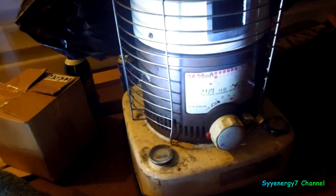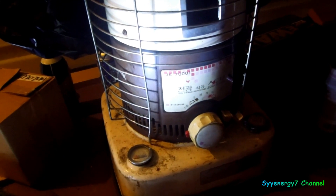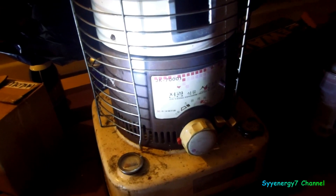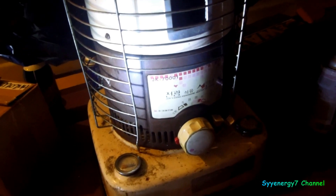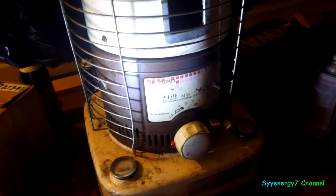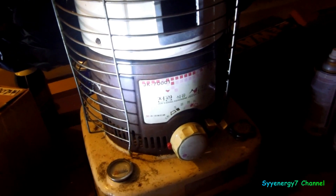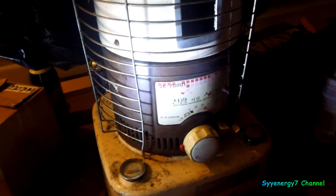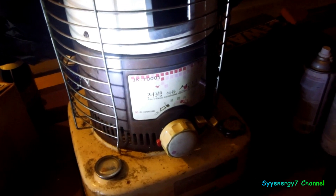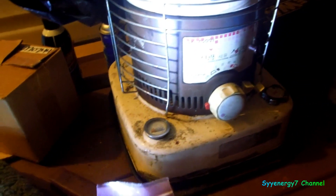I just want to say that I ordered another kerosene heater because I'm curious about this. I think it's the 100% cotton wick that's really why this heater works so good with ultra low sulfur diesel fuel, with one ounce of 90% isopropyl alcohol per gallon of ultra low sulfur diesel. So I ordered an old-time Perfection heater — I think it's the model 1550 — and I'm going to test it when it comes in with some ultra low sulfur diesel.